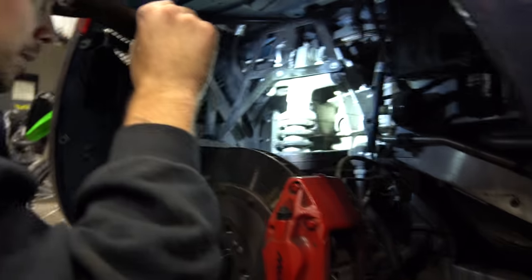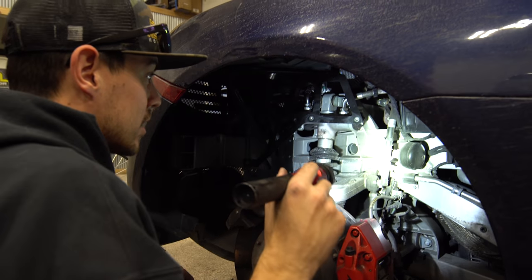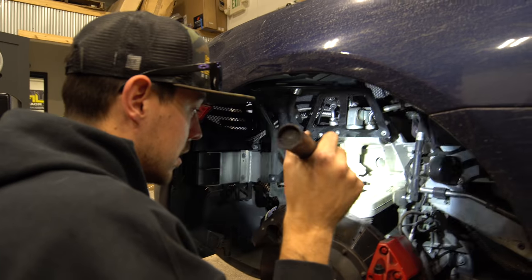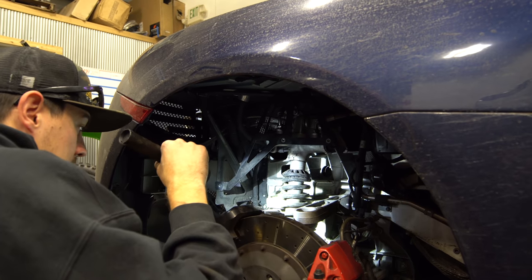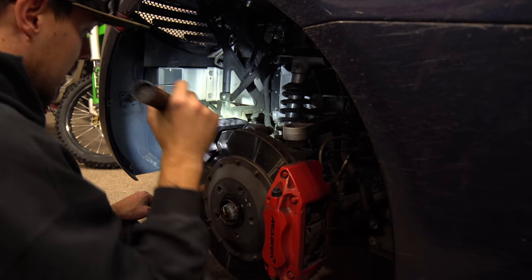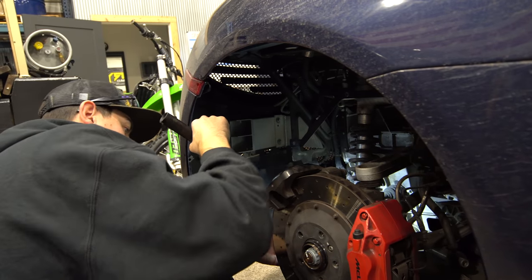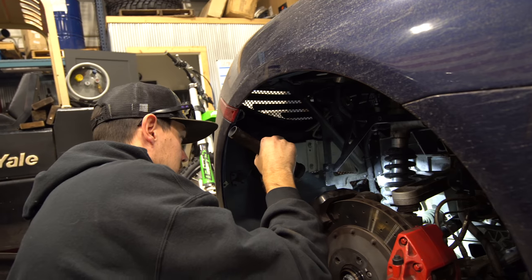To be completely honest, people are intimidated about these cars. Just kind of looking at it, they actually simplify it. There's a lot going on here, but for the most part, it's literally the very minimal amount of things that you need for a car. And it's not crowded either. At least the suspension components don't appear to be crowded. It's just an upper control arm, a lower control arm. What's kind of interesting is that there's a tie rod in the back. It's fixed, so it doesn't have steering in the rear, but it's interesting that that part is there. Makes it easier for alignment purposes.